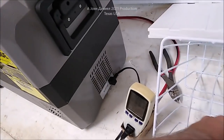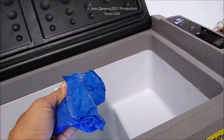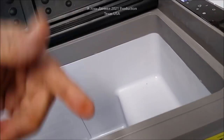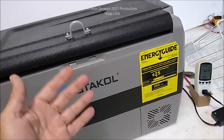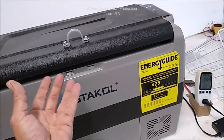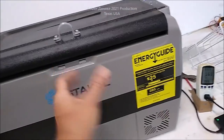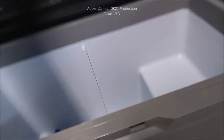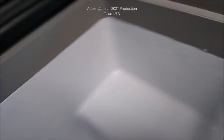A smart tip: take some blue ice packs. If this unit has been sitting at room temperature and you need to start it up, throw a few in there, close it, and power it up. That helps it draw less power because it allows a shorter period for the unit to remove the existing heat. Remember — refrigeration doesn't make cold, it removes heat. The absence of heat is cold.